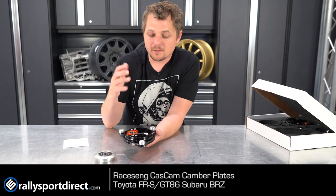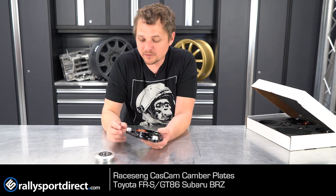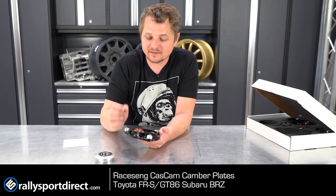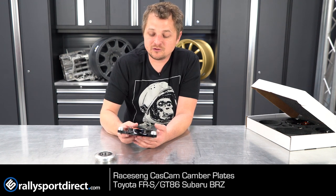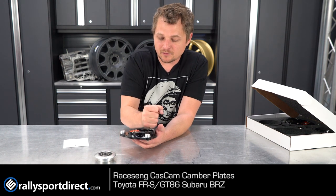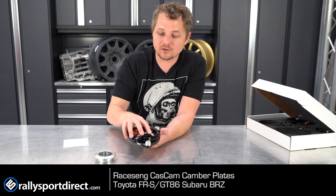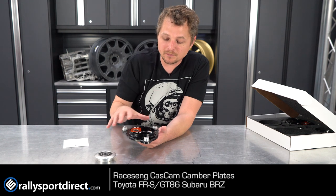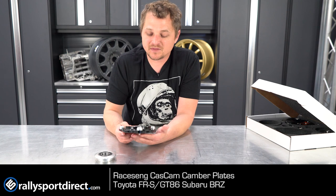What that is — between this piece and these pieces — that gives you camber and caster adjustment. I do know that there are other plates out there on the market that do it, but nobody does it quite like this. I think this is actually a pretty ingenious way to do it, because it gives you the ability to adjust both independently without having to really mess with this center post trying to get it to where you want it. You can set one and then move the other without really messing with the other one. So they're independent camber and caster adjustments, which I think is just absolutely killer.